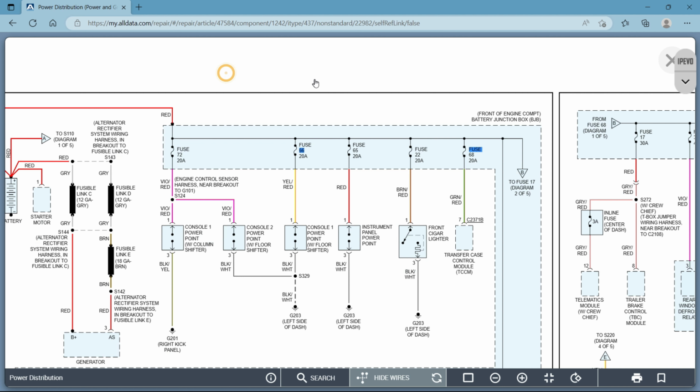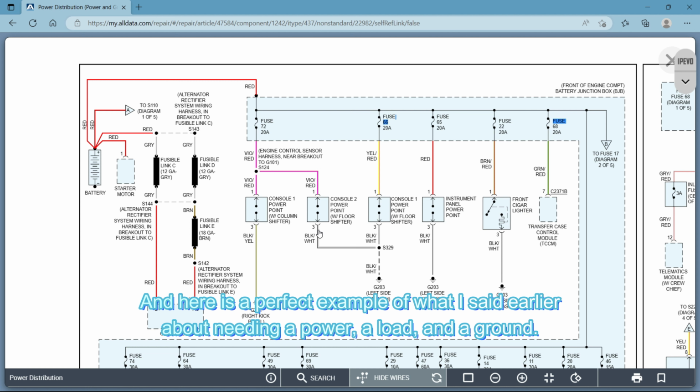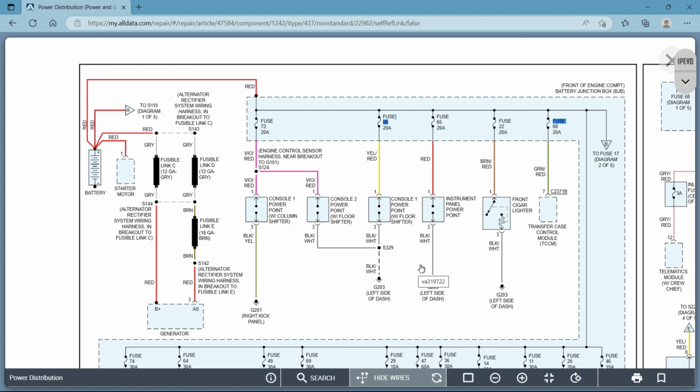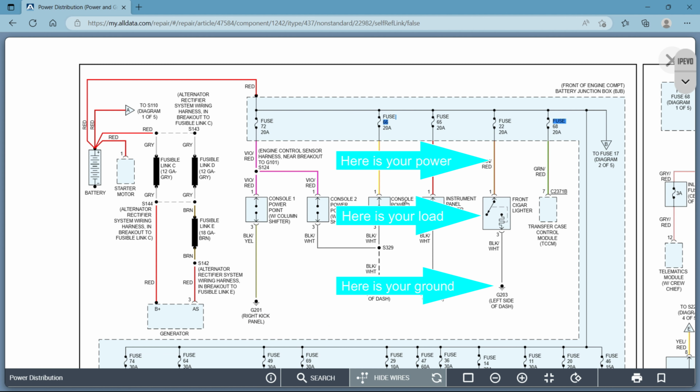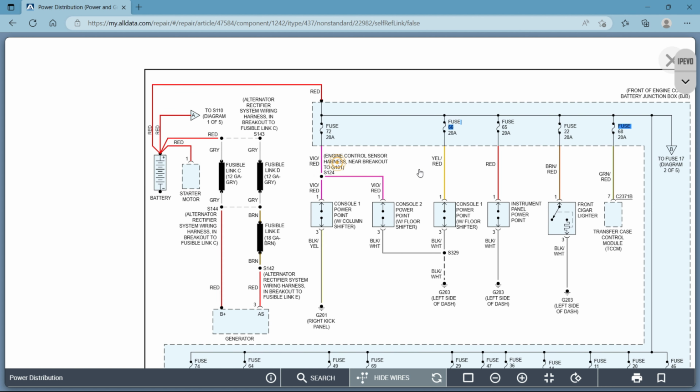Okay, so here's a good example of what I showed you earlier in the video, there was a little square wave symbol. It looks like that. That was a heater circuit. So that's a heater circuit here, and look what it's for. Cigar lighter. Another common place, like I said, that you'll see them is on most of the newer cars now. The oxygen sensors have heater circuits on them to help make them more emission efficient earlier. As soon as you turn a car on, instead of waiting for the temperature gauge to get up halfway, the heater circuit helps with that on those oxygen sensors.